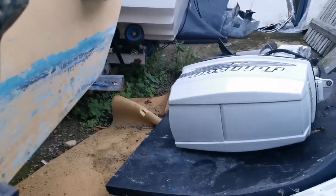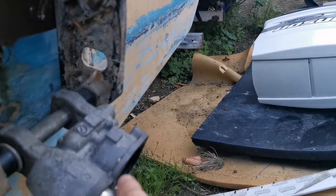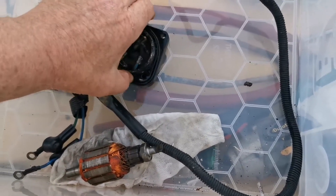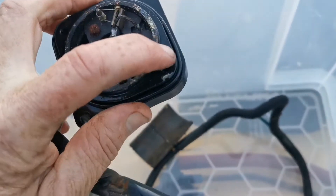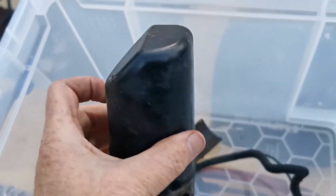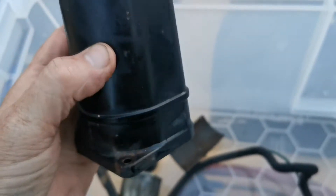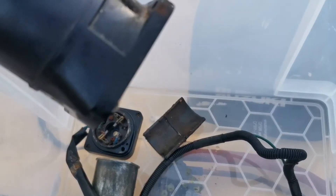Then the arm drops down, which enables you to get to two allen bolts — they're diagonally apart. There are two allen bolts there and there which hold the motor on. This top cover is also the reservoir, and there's a level or filling screw on there as well. When you unscrew them, the motor will pull off — there'll be fluid coming out so be careful.